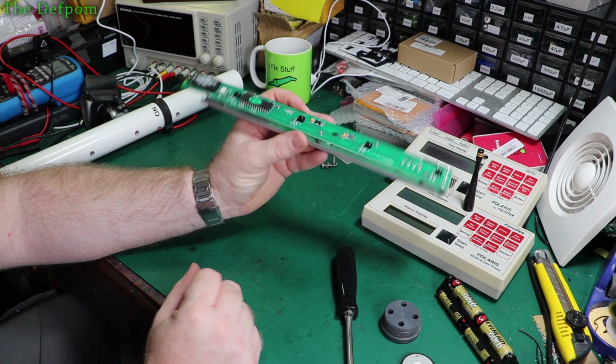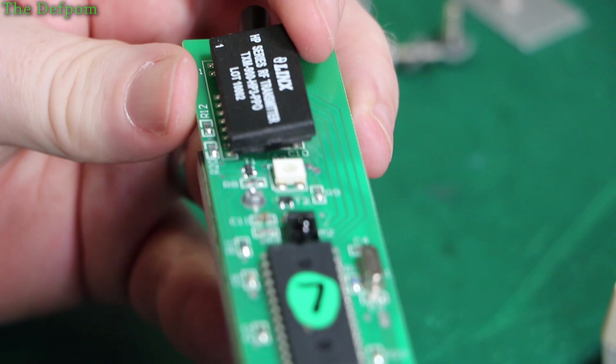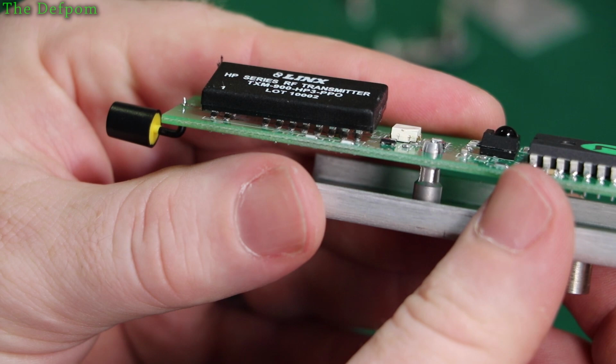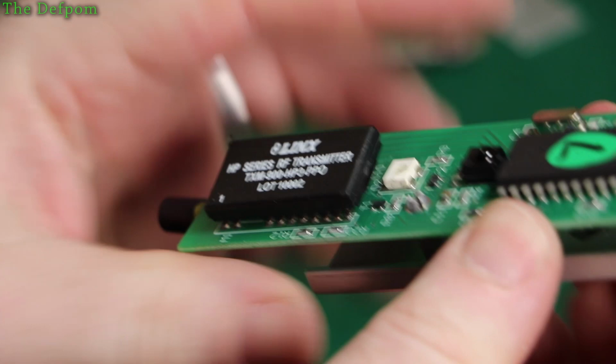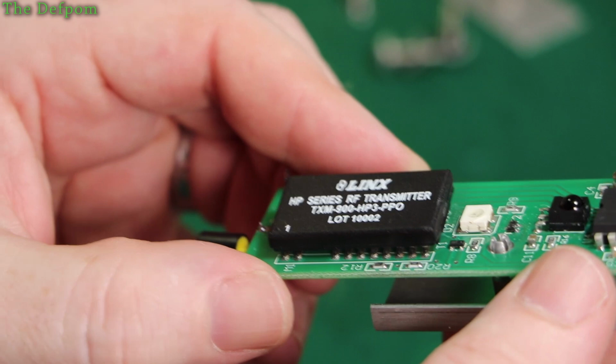The fact it's wobbling around on that circuit board there, it's just sitting there floating around, not secured. Maybe it's been banged, maybe it's got some cracked solder joints. Actually, those joints don't look the best, do they? Some of those do look quite bad, actually. So I'll resolder this whole thing. I'll resolder this module here, and maybe the antenna as well. Oh, that's probably all right, she looks okay. And we'll see if that does anything to help it, just in case it's that, because it is intermittent. Apparently it does sometimes work, sometimes it doesn't.